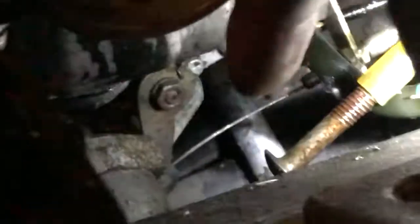So when I set up my cables, there's just a screw adjustment on the cable here. Ooh, there's my finger right behind the oil line there. There's a screw adjustment on the cable right there to tighten that cable up, and there's the mark. Woo. So I gotta get that set up. That's just dripping away, so I'm probably gonna pull this carb and check that out. I gotta set that, and then I gotta tighten these up. Man, whoever had this just, wow.